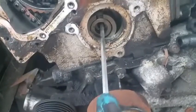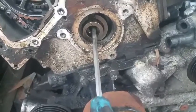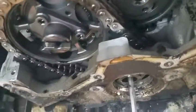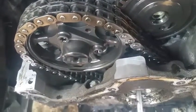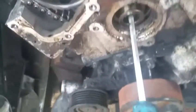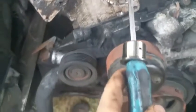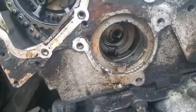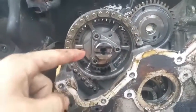What I ended up doing is prying this little roller off and putting a screwdriver on it. As you can see, it kind of tensions the chain — you can see it's with the gears. I'm going to pull the center piece off; that other gear will most likely fall inside but it's okay, I'll fish it out later. The chain is now loose.